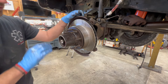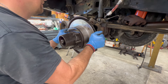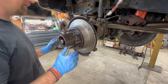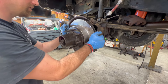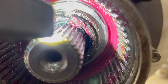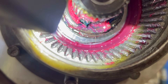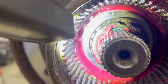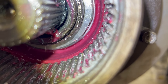What the book says next is you torque the nut to 16 inch pounds. What I personally like to do is torque it to feel — what you have to do is have no bearing play whatsoever. So if you want to go to 16 inch pounds, see if that gets all the end play out. If it doesn't, just keep adjusting it back and forth till you have no end play — you don't want to seat the bearing too tight and you definitely don't want it too loose either. So that bent-up piece I showed you earlier is the locking ring — it goes in the groove at the top and around that lip on the nut. It's got little teeth that lock into the inside threads of the nut. Make sure it's seated all the way in that groove, and just take a screwdriver to make sure it's seated all the way down.